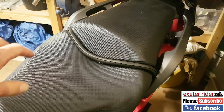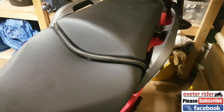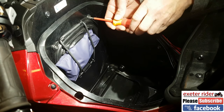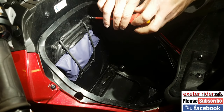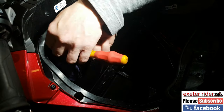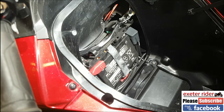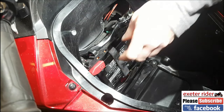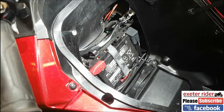In most cases the battery is kept underneath the rider seat on most bikes. However, on the Honda NC 750X the battery cover is in the front itself. Just a couple of screws — this here is the toolkit if you're wondering. We've got your positive here and the negative over here; these are screw connectors, very easy to disconnect.